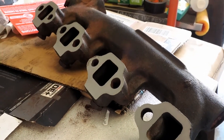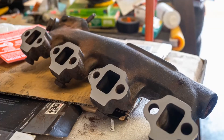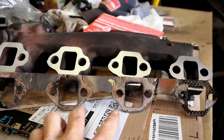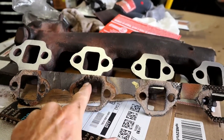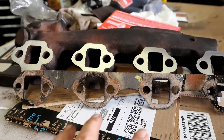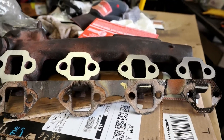I'll get the gasket and show you. There you can see the gasket. The two center ones were pretty well sealed — you had a little bit leaking here — but the front and the back were totally gone. I'm thinking the two center ones pushed the manifold away and then it started leaking and burned out the gasket.